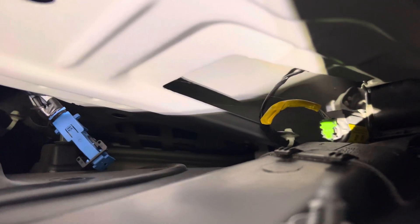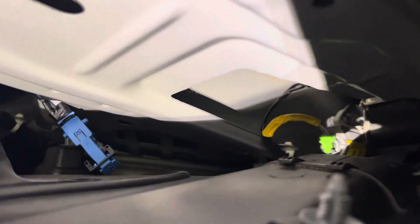The Blue and Me module is located in the back of the car behind this panel here, which I have unscrewed. If you get behind there you can see that blue plug — I've unplugged it. Behind that there's a metal cage and the module is in there. It's just a plastic module; you can reach your hand in, unplug that blue plug, and then come back to the front.